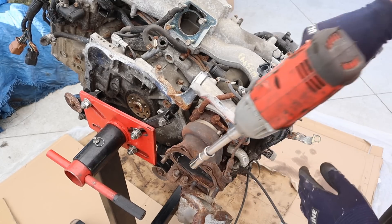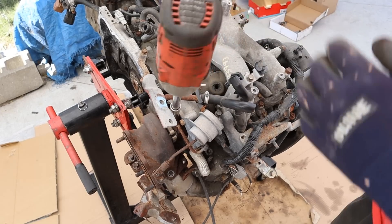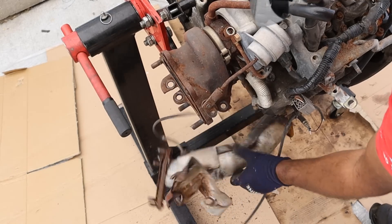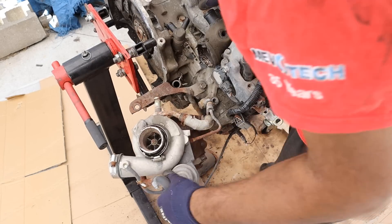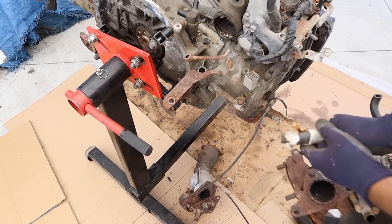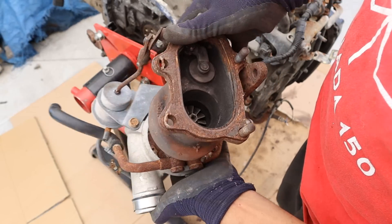In order to access some bolts for this intake, I'm going to start by removing the turbocharger. I'll remove the oil feed line here. With some of the bolts left, I can remove the up pipe and then remove the turbocharger — there's one more line for it here. And here's a look at the turbocharger. Comment down below if you want a separate video on how a turbocharger works.